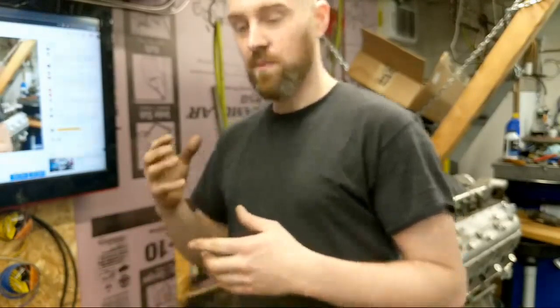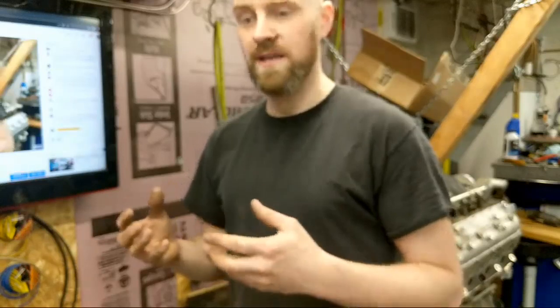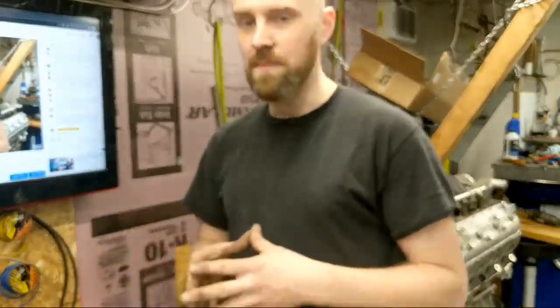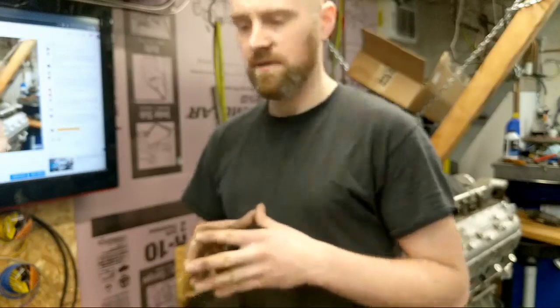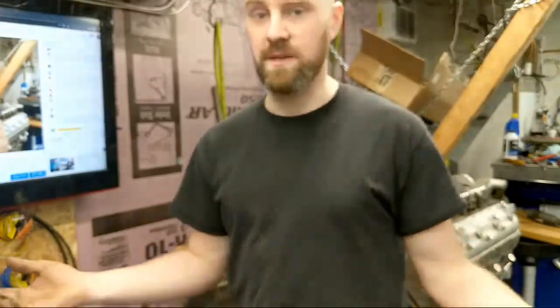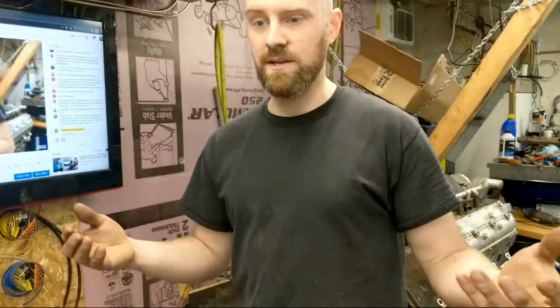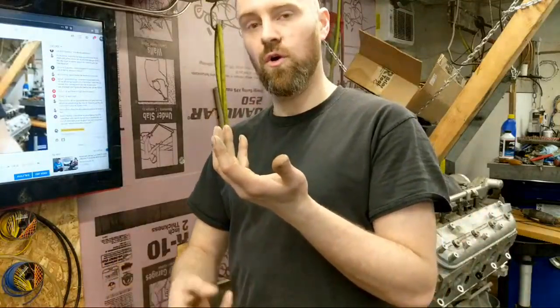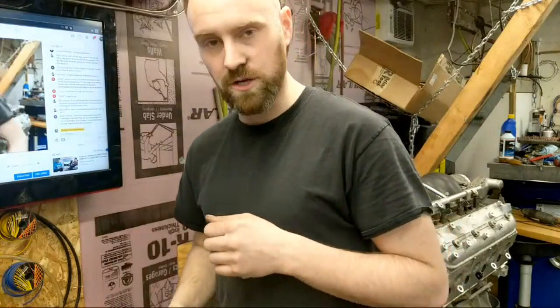Now, what I'm really curious about, and I'm hoping that he pulls the VLOM off and looks things over and finds out that it's feeding pressure, I'd actually like to get a hold of that VLOM. I should probably contact him this morning yet. If I can get a hold of that VLOM, I'm curious why it would fail if it's not being activated, because that system is disabled. It should not have a problem. I don't know if maybe there's just so much sludge in that motor that feeding through the holes past the lifters, it's actually plugging the screen. I'm going to go grab the VLOM quick so I can show you.